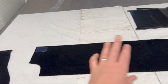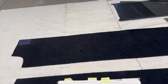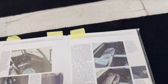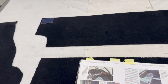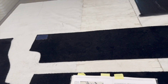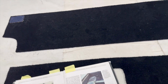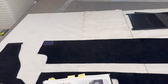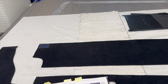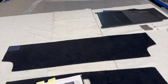So obviously you can put carpet on the rear bulkhead on the BJ7s and BJ8s because it's not going to get wet because it's got this clever gutter system. Whereas the earlier cars, say the BT7 for example, they should have vinyl on that section because otherwise the water from the hood's going to drip down onto carpet and make it all soggy and smelly. Quite a few other companies out there, as standard, supply carpet for all of those cars there because they've tried to generically make the carpet set exactly the same for each model, whereas we haven't. We've kept true to originality and suitability.